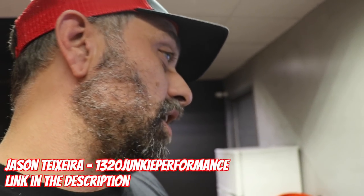I'll give Jason credit there — he said it was going to be 70 horsepower and it was 61, and it's still climbing. Awesome. Alright so we've been chasing this for a week. This is not a tuning issue — this is just figuring out the new setup. Yeah, basically when you get into this range everybody wants to make big power. This is probably blower-wise like the third most powerful GT500 we've had on here, and obviously the first one with the 3.8, which the blower setup hasn't been completely worked out. We outran the intake that was on the car. With pretty much the same tune other than changes for the cold air intake, we're at 61 horsepower gain — so let's make some changes and try to crack 1200 with it. I think we'll get there.